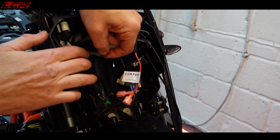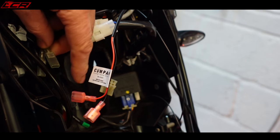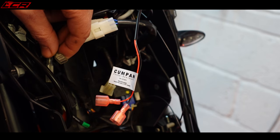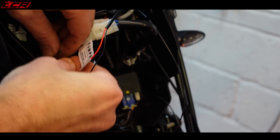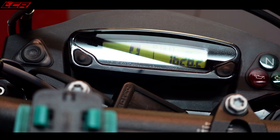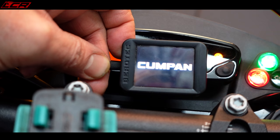The instructions say the red and black wire connects to the red wire from the cockpit assistant. There's a lot of protection on these — there's too much sleeving, so I'm going to have to cut some of that off. I'll slip that inside and push the connectors together. When we turn that on now, because we're connected into ignition, we should have power. Oh yeah, look at that!